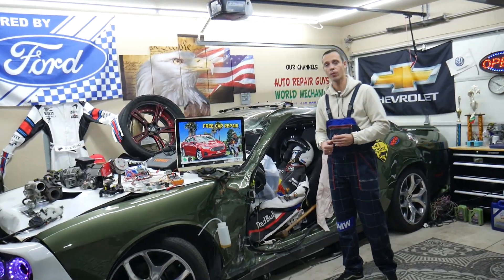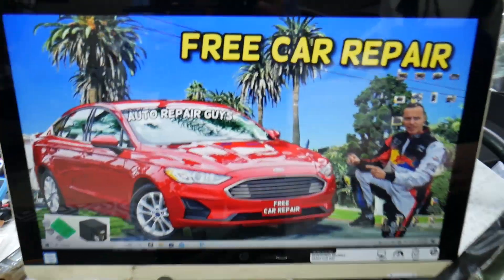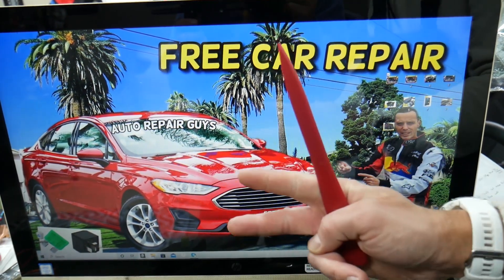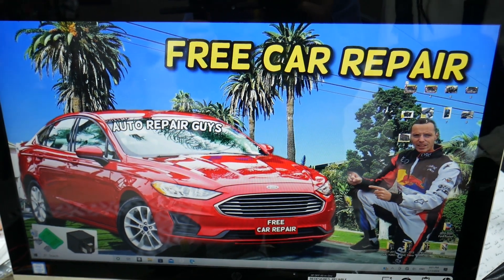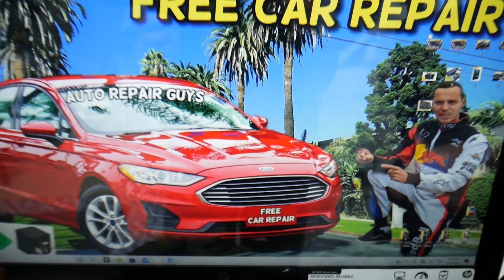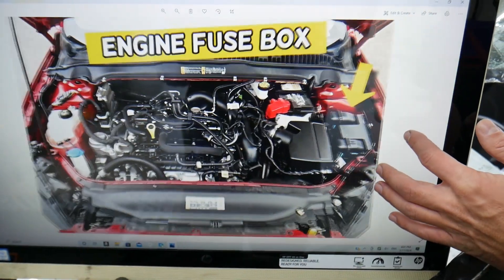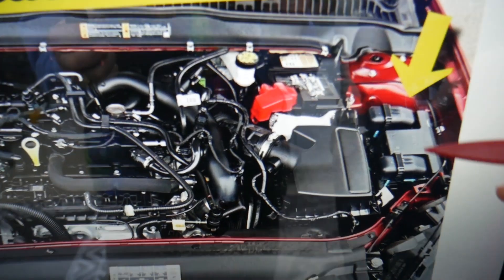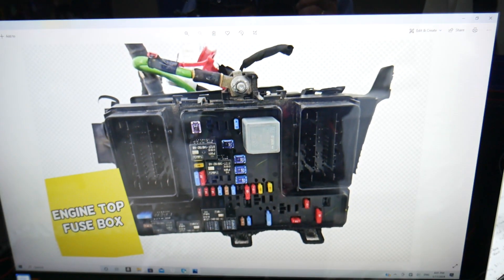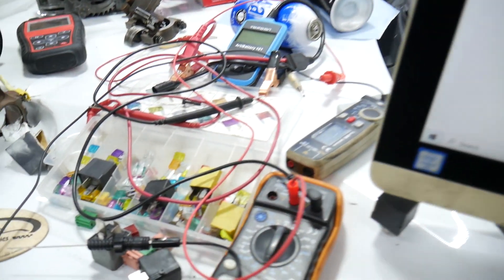If power steering does not work, we're going to demonstrate what can easily cause that on this generation Ford Fusion. We have multiple fuse boxes that we need to check — two fuses control power steering, and one of them is extremely hidden. We recommend checking the video on our YouTube channel about fuse box location on Ford Fusion. We need to go under the hood on the driver's side, under this cover that looks like a T. You have a fuse box that looks like this — that's the main engine fuse box.